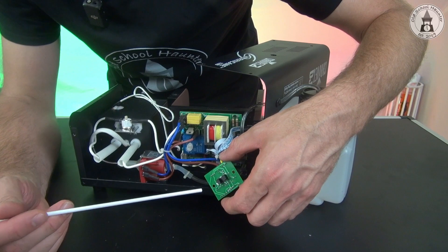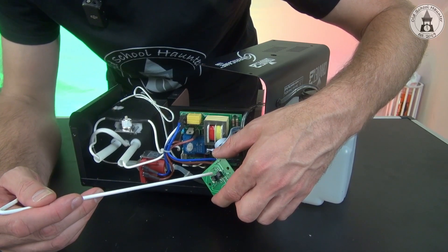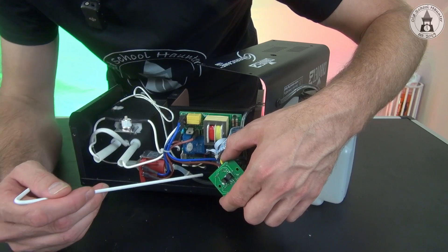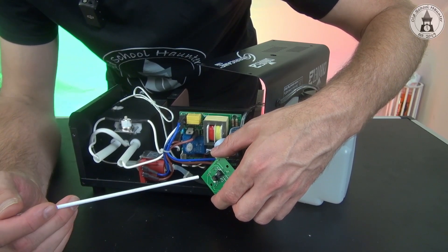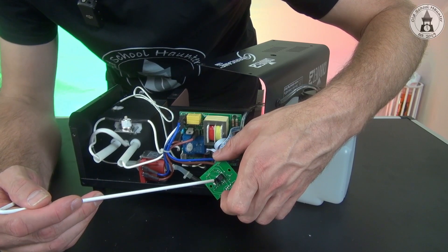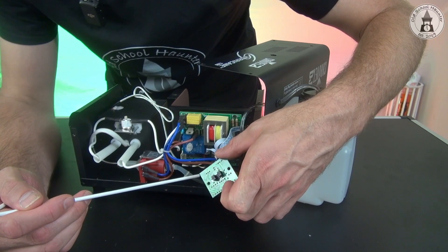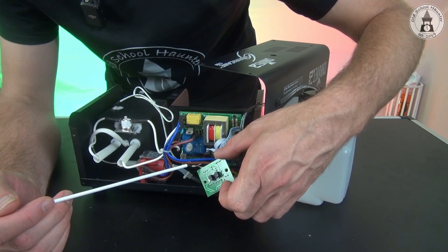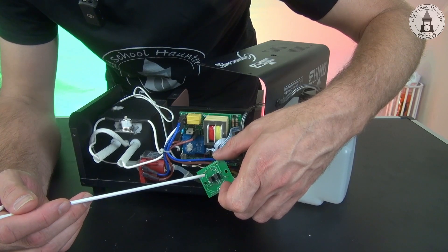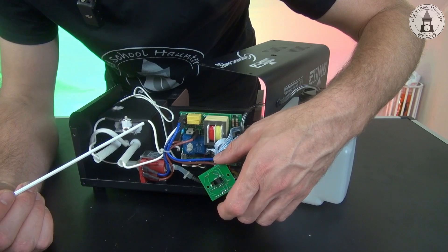So what I did — I took some kitchen paper and removed the humidity, dried the sensor, and dried the tube again. And yeah, that was pretty much the problem. This sensor is also well known to get dirty over time, so it is a good point to start tracking down the issue here. Remove dirt from the sensor because otherwise it will report faulty values to the machine.